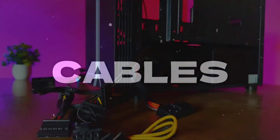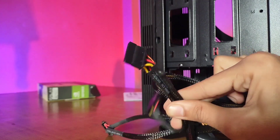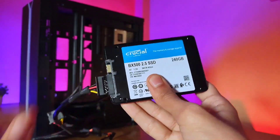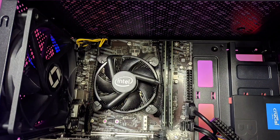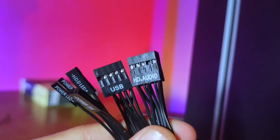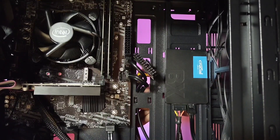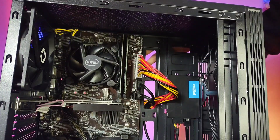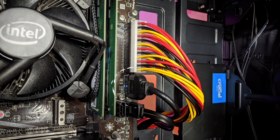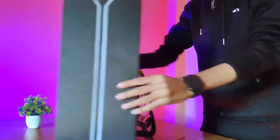Now the most intimidating step of the build — the cables. Honestly, I didn't understand at all which cable goes where, so I watched some YouTube videos and then I was ready. The SATA power cable goes into the SSD; one end of the SATA data cable connects to the SSD and the other to the motherboard. The CPU power cable connects to the top left corner of the motherboard. The case cables connect at the bottom. For the 24-pin cable, I realized it was too short to reach the motherboard, so I bought an extension, connected one end to the cable and the other to the motherboard. Finally, I connected the USB 3.0 cable. The PC looked great from the front, but the back told a different story, so I got some cable ties and spent a while on cable management.